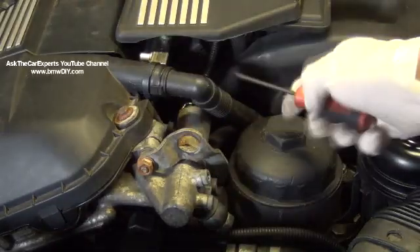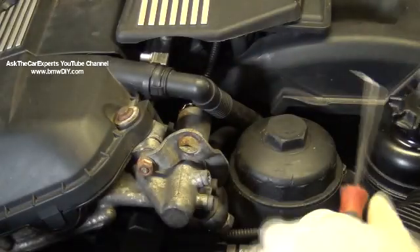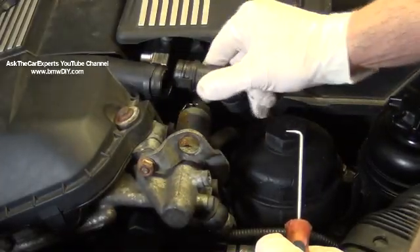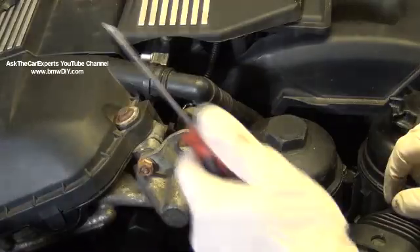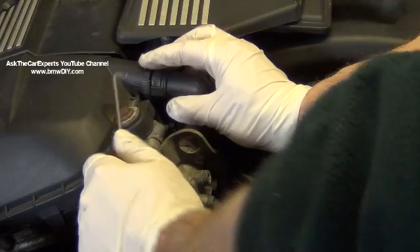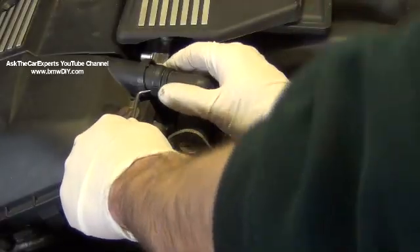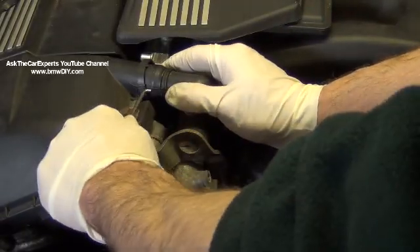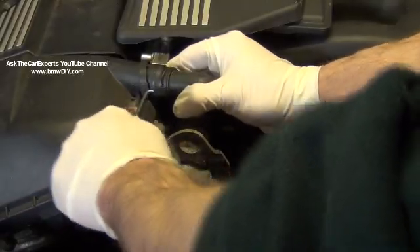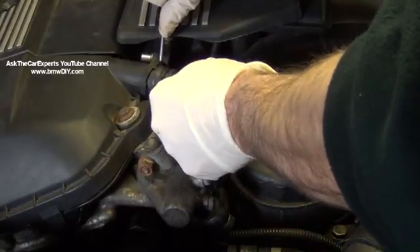The Vanos solenoid is right here. The first thing to do is get this upper line out of your way — this hose that goes down to the cyclone separator. Mine is actually broken on these two tabs here, so I have to replace this line. You just use a 90-degree pick. This part here is broken — it should be attached there. You go on the inside here and basically work these tabs free. Push them out carefully; get one side started, then come from the inside, do the same thing, and wiggle it free.